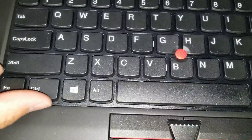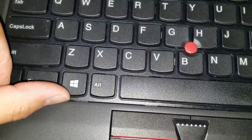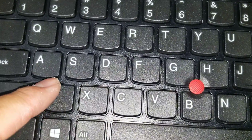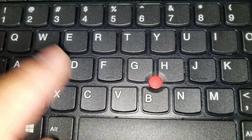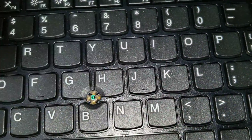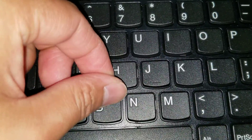Some of the models don't have that. Basically you would just pull this up. Once you pull this frame up, it will go underneath the keys, and there'll be small little Phillips screws there. You'd probably have to use a Phillips 0 to remove them. Usually you don't have to remove this to do it — you can leave this in place, but if it's having problems, you can try removing that.